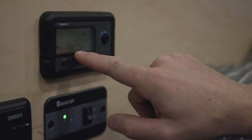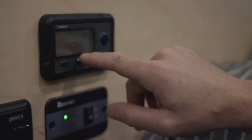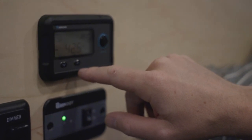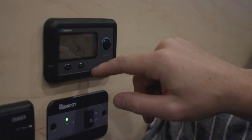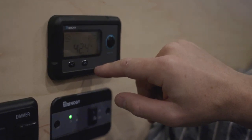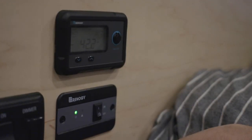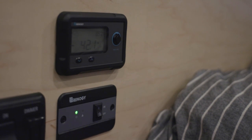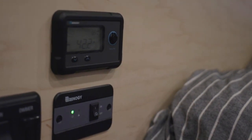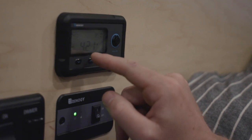Looking at the battery screen right now, we're at a deficit of 42 amps. With lights on and the fridge running, we're drawing high 30 amps just to run the stove at 300°F — that's a lot of amperage. You have a big battery bank in these vans. The induction cook stove is great for boiling water, making pasta or coffee in the morning, but don't depend on it for feeding a large group — make sure you have a backup cooking source.